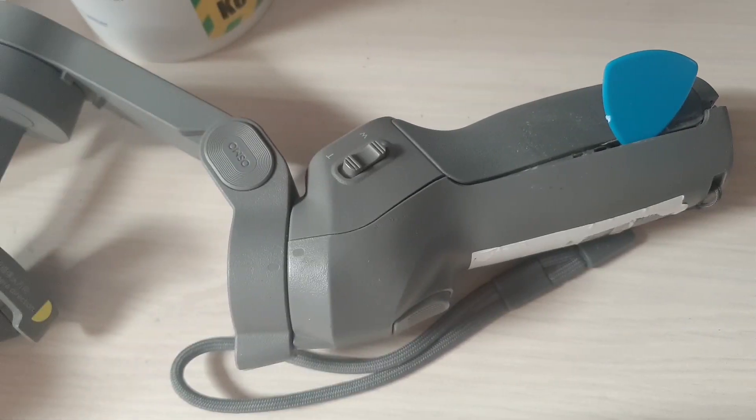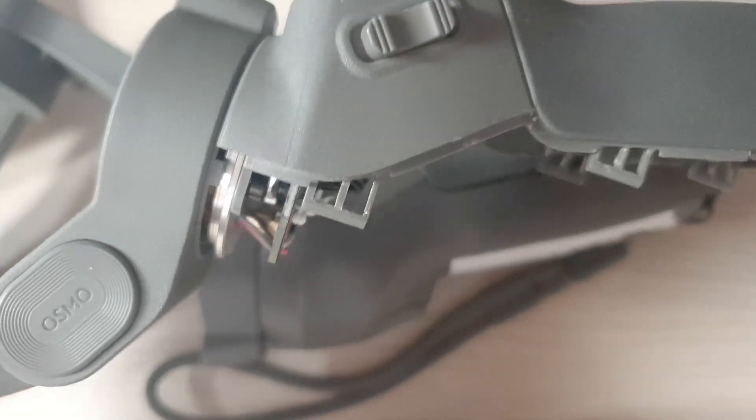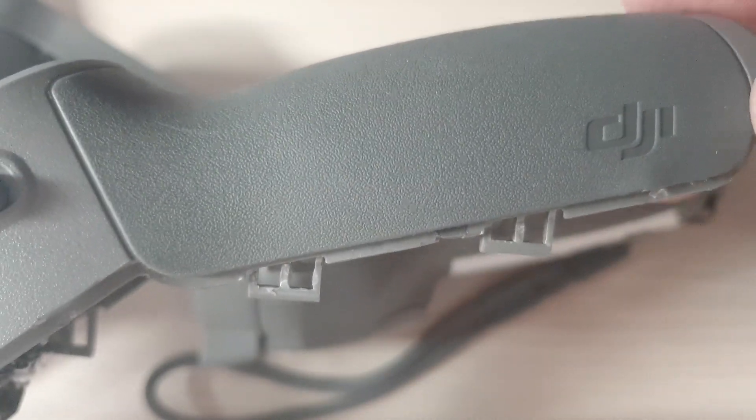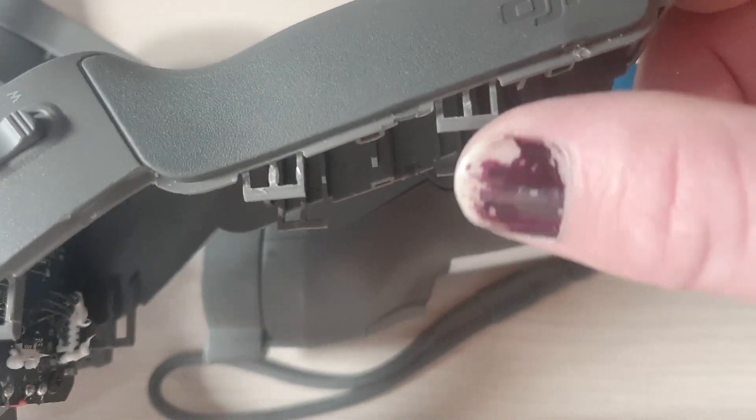Back to the Osmo. I said I wasn't going to do this, but hey, what the hell. Having looked at the one I've taken apart — yeah, it's fiddly, but is it worth the risk? We'll find out at the end of this video. The trick in taking anything like this apart that's got lugs rather than screws is knowing where to apply the pressure. Videos like this may help people know exactly where the locking lugs are. To apply pressure, you need to apply it basically on the cushion part of the handle in the spots shown, then exactly corresponding on the same positions on the other side and around the top. This pressure must be applied to the handle area, not the part you're going to take off, because it's those little spring-loaded lugs that are doing the clipping.